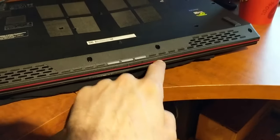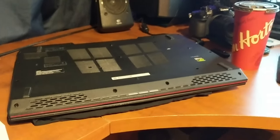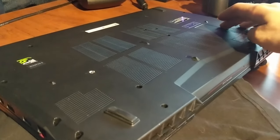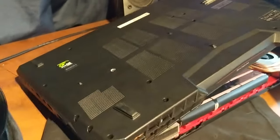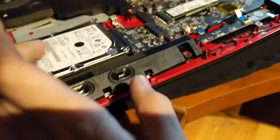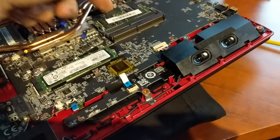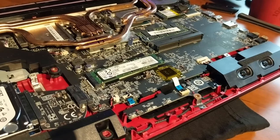So there are 20 screws. Once that's done, we just have to pry in between the red and the black. The red stays down — that's part of the palm rest area — and the black part just comes up. You have to go from the non-optical drive side to the IO side, because the audio jacks and IO you have to pry up and then out. This layout is far different from the other motherboard I was looking at. This one actually has a hard drive where I was going to put a second one, so I can only have one hard drive in this.